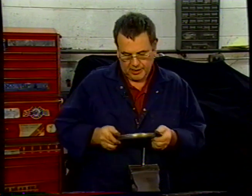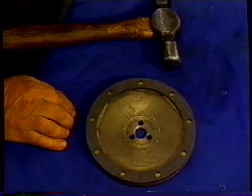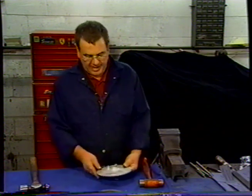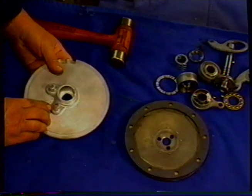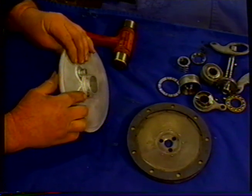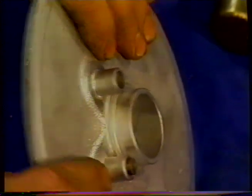The note's changed, and that's all nine rivets in there, and that completes that process of riveting on the servo lining. We're now going to flatten the servo plate and put the servo together, or rebuild the servo. You can see here that one of these plugs is sticking out a bit. For demonstration purposes, I've left a plug sitting out a little bit there.